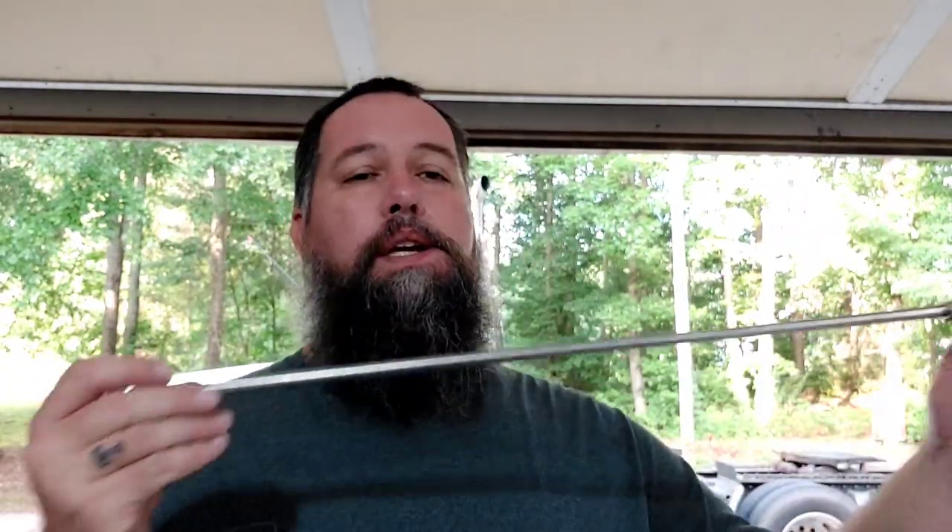Let me show you the antenna I'm talking about running — this is the Hustler SCB. It's got a 24-inch stainless shaft with your standard 3/8 input. One of the good things about this antenna is that the top is spring-loaded so the whip can actually bend if it hits an obstacle. The whip is only about 24 inches — maybe 22 — because on the back of this truck the maximum height I have is about 54 inches to get to 13'6". So this antenna being roughly about 4 feet, it's going to be a good choice. The coil is mounted high, which is good to get over the cab and the horns — it's not going to be over the stacks, but it is far enough away that it should not matter whatsoever.